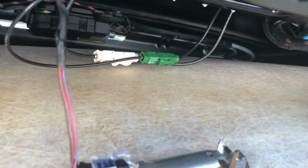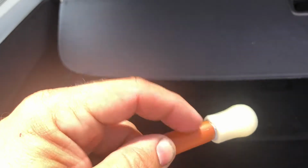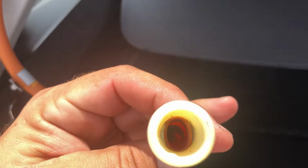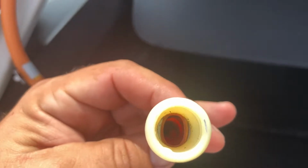And the first thing that I noticed, as soon as you see this, you've got to watch out for this staining right here. You look and you kind of know where your water's coming from, and I don't see any staining over here in this area where the antenna is. And you also notice it over here, kind of moldy, cruddy looking staining there. So what I noticed was, as soon as I let water run, I saw water dripping right in between those joints. And you look in there, and I filled it with silicone now, but you can see how it's kind of squeezed in, and you could see right through there.